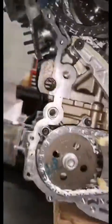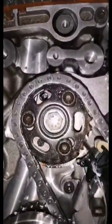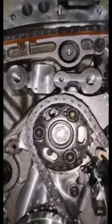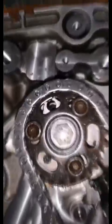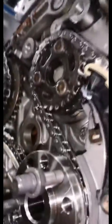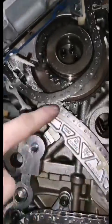For the crankshaft to now set in its timing position, the first thing to set up here is a small balance shaft in the center of the engine, and there's a small pin that you put into that which locks it in place in the block — that's to remove harmonic frequencies from the crank. The primary cam drive chain is not timed; those just go on, you don't have to worry about it.